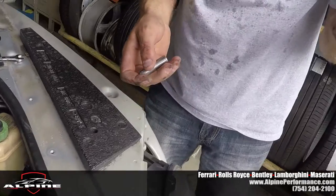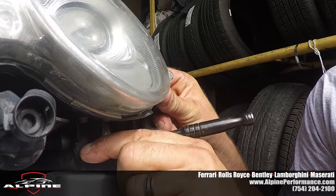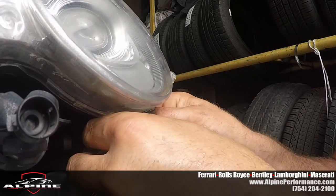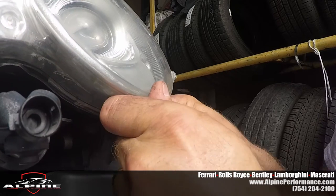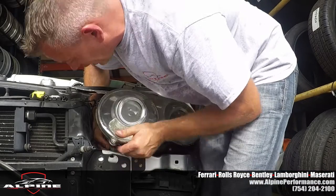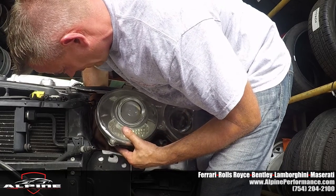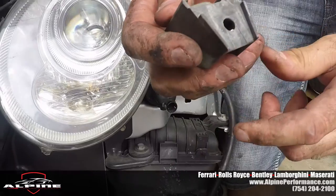This is the last bolt. After you take out all the bolts, you want to loosen this bracket on the bottom — that's 8 millimeter, or Torx T20, whichever you have. It's a little bit hard to get the screws out, but you just have to play with it. Those are the screws that hold in the bracket, and the bracket is just going to come up. This is the light bracket. Now there's another bracket on the right side of the light, right here on the bottom. If you stick your hand through behind the light, there's a clip. You have to press the clip and release the bracket — push it down in order to release it, and the bracket just slides out.